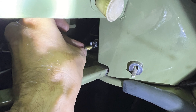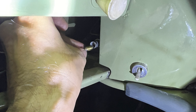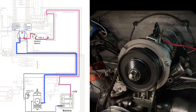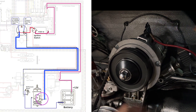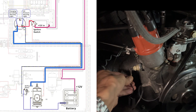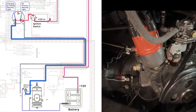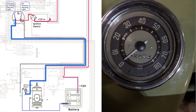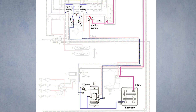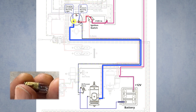So the first thing I checked was the bulb of the charging light. I took it out and it looked fine. The next thing was to test the wire. I disconnected the wire from the charging light at the alternator and connected it to the oil pressure switch. I turned the ignition key and the light came on, confirming that the light bulb and the wiring were not the cause of the problem. If it was, it would have been a very simple problem to solve, but it wasn't.